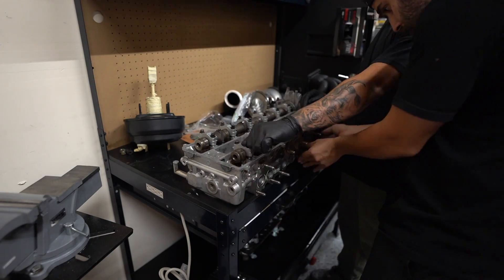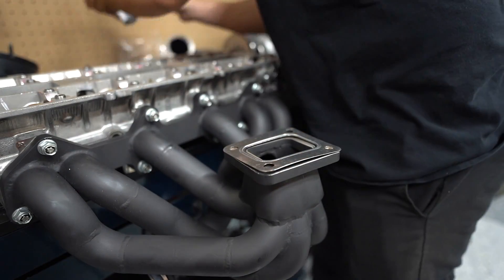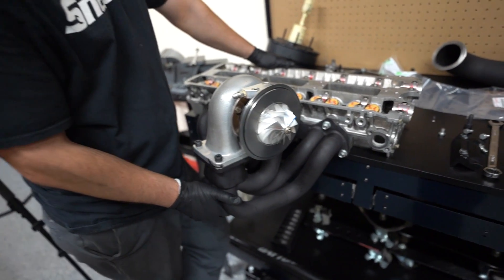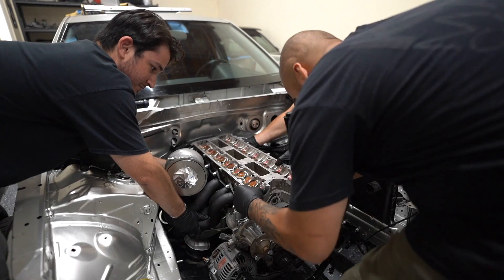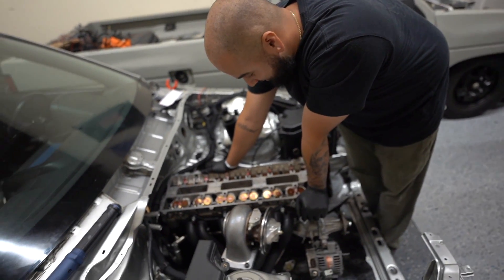We're a little scared about leaks — if it leaks, we redo it and paint the engine bay a different color. Maybe green? Now you're talking. We have the turbo mounted and when we removed it we had difficulty with the bolts, so what we're doing now is running Allens for three of them so we can use an Allen key to tighten the one furthest to the turbo manifold, then running a bolt I can get with a wrench in the back. It sucks wanting to keep everything the same, but things get tight and you work with what you've got.